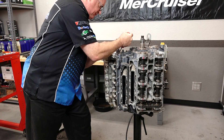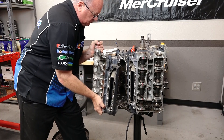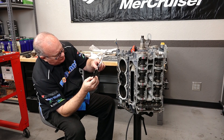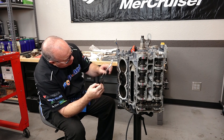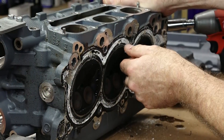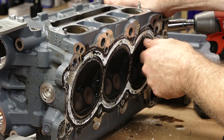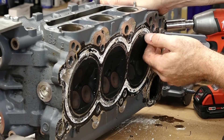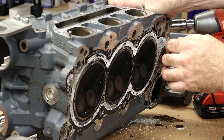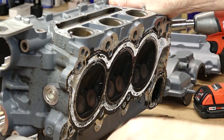What I'm looking for here is to see if the head gasket was blown anywhere. It does not appear to be from what I see so far. We might be able to reuse these — I won't know until I get them completely broken down and cleaned up. But those two areas might explain why we were losing so much pressure on compression and on the leak down. It looks like it was blown through right there. If you remember, it was this one that had like a 75 or 85 percent loss on leak down.